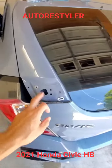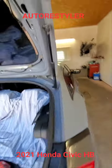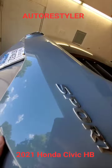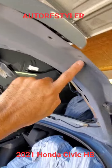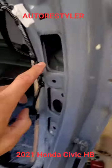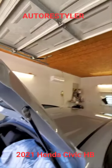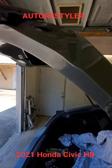This little piece right here — we gotta take out the light right here and break off this piece right here. So just take one, two, three, four — these two right here for the light. And then there's another nut right here. Disconnect that. If you got that off, it does have another little plastic clip — pull that off, do that on the other side.